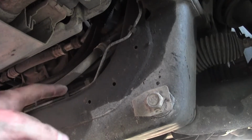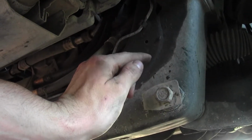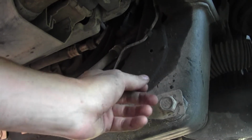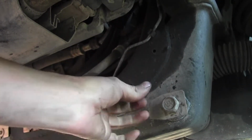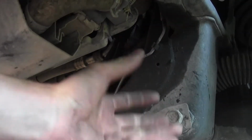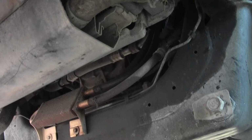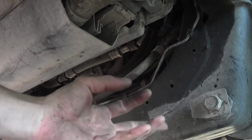The next thing you check, if you have an older vehicle that has a conventional gearbox, especially if it's a Ford, I know it'll have a threaded shaft on the top, and it'll have some sort of hex at the top of the shaft or a reverse Torx or something, and then there'll be a nut. So you can crack the nut loose, tighten down the shaft kind of as far as it'll go, wiggle the wheel, tighten it, and then back it off. I think it's a quarter turn, and then tighten your jam nut. There's supposed to be a set amount of slop in there, but you can take up a little bit of slop in the gearbox. In my case, I have rack and pinion steering. There may be an adjustment, but it's buried pretty far in there, and I'm not going to worry about it because, again, I know part of my problem, at least, is further down.